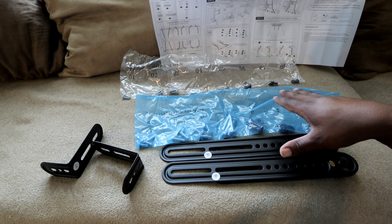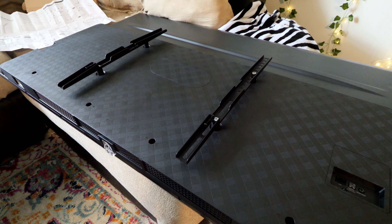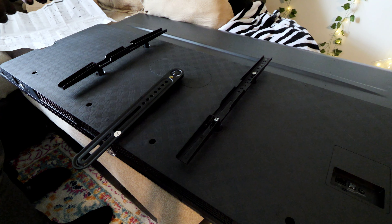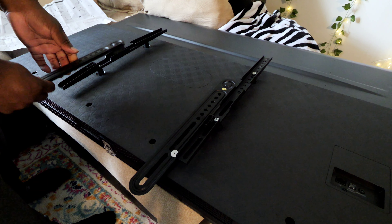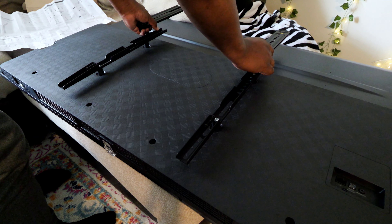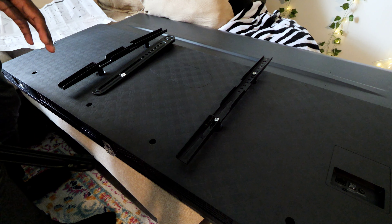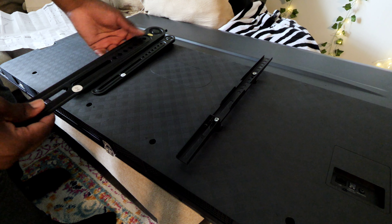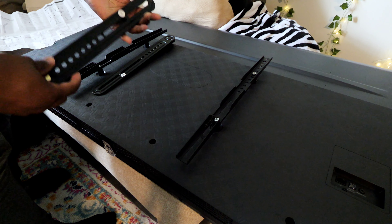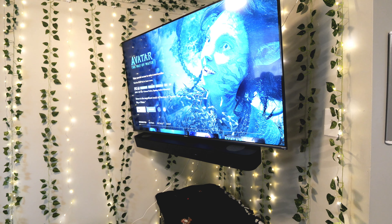TV is down — super easy to disconnect it from the wall mount. The purpose of taking it down is these brackets are going to share the VESA mount holes that are in the TV, and essentially they'll mount just underneath them so the soundbar can rest flush underneath. You can even use the top and connect them from the top if you want it to be above your TV, but aesthetically it's going to look a lot better underneath. So we're going to take the screws out, place the brackets, and adjust them — they swivel — to get it nice and flush underneath the TV.